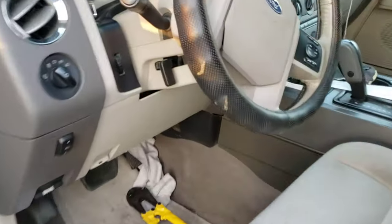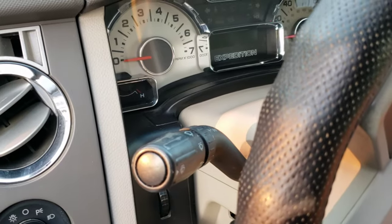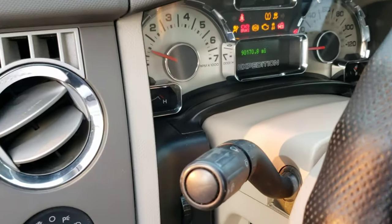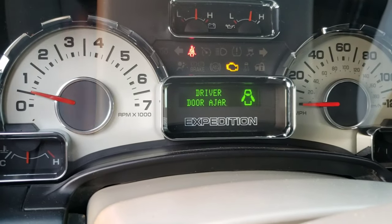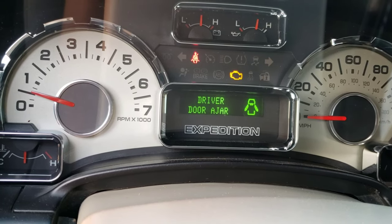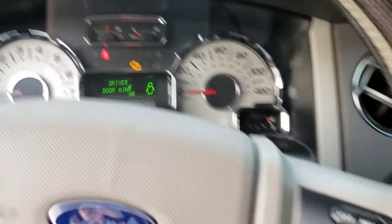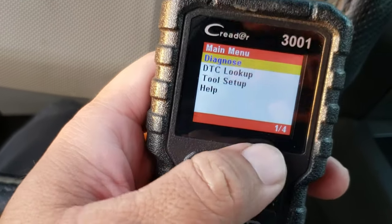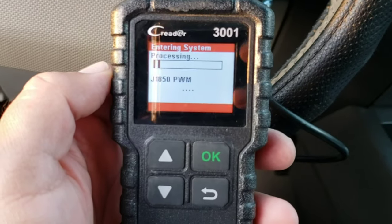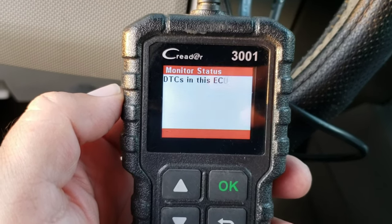Let's see if those warning lights went away — we didn't have those before. Oh my goodness, they're right there. We still got an engine light on that we didn't have before. Let's find out what the check engine light is — let's diagnose. I believe it's just because I turned it on without the mass airflow sensor connected; once I start driving it'll go away.